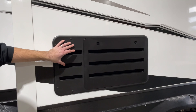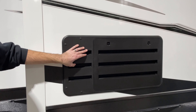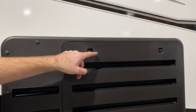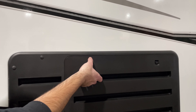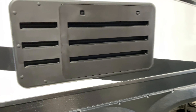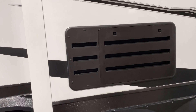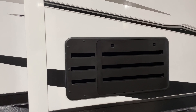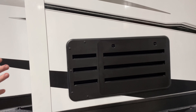These vents are your refrigerator access vents — more or less a maintenance-free area. You can remove these panels with a flat blade screwdriver by turning each one vertically, getting your fingers into the vents, pulling out the top first, and the bottom is simply held in by four pins. Really the only time you need to get back there is maybe for an annual spring cleaning to make sure all the bugs are removed and there are no colonies hiding on the burner assembly. Other than that, it's a pretty maintenance-free area.